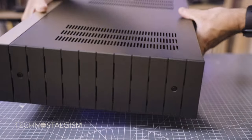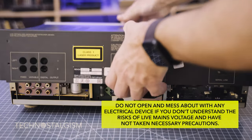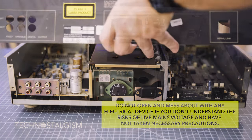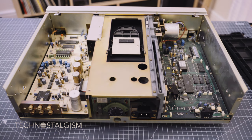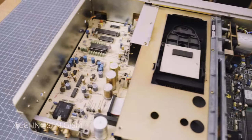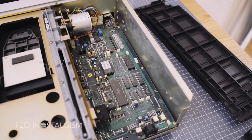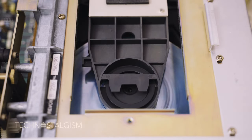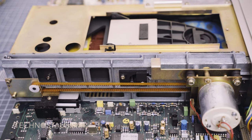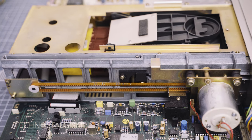Let's first remove the side panels. There are two screws on each side, five more at the back, and we can lift up the cover. Hiding beneath is a very tidy, almost computer-like built device. All main blocks are laid out on separate boards to the left and right of the center-placed transport. Revox uses a very solidly built and reliable Philips transport. Just look at how even the CD tray mechanism pretends it's a conveyor belt.